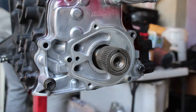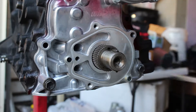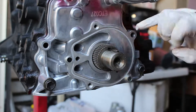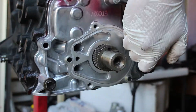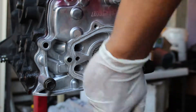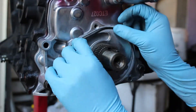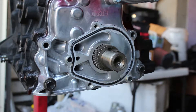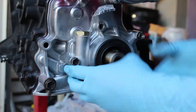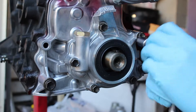The way you install the crank spline for the oil pump is that the splines have to be pointing outward toward the outside, not toward the inside of the block. All I'm doing here is just heating it up to get it to go in smoother — it actually goes in very smooth. I also use silicone sealer to set in the gasket because the gasket is going to want to fall out, and setting in the gasket with the oil pump gets kind of tricky. I put a little bit around the seam just so it locks in the gasket and it doesn't move when I put in the oil pump — that's one of the tips I'd give you guys. And don't forget that the top bolt needs thread sealant or else you're going to have a leak.